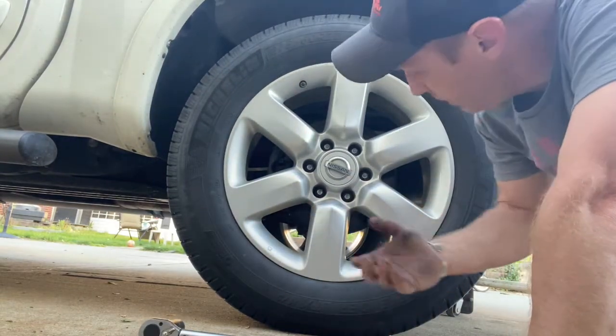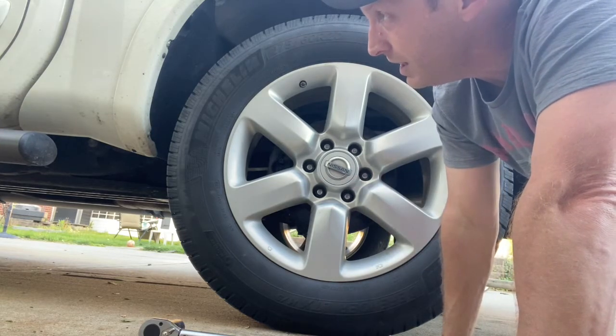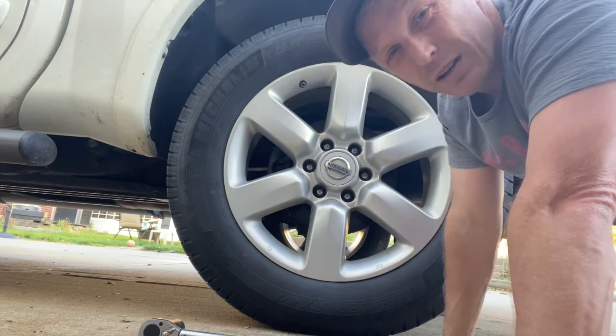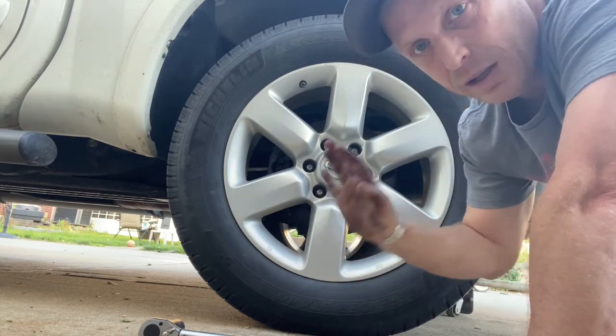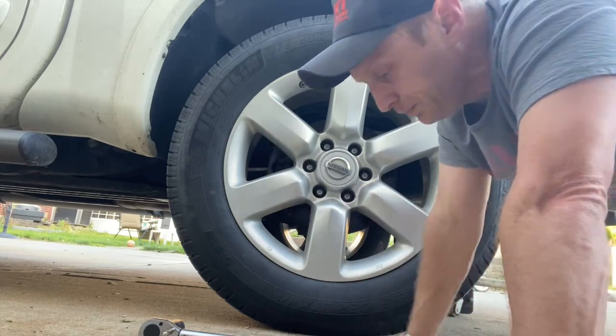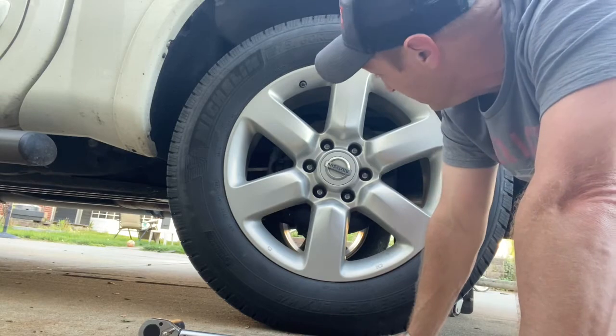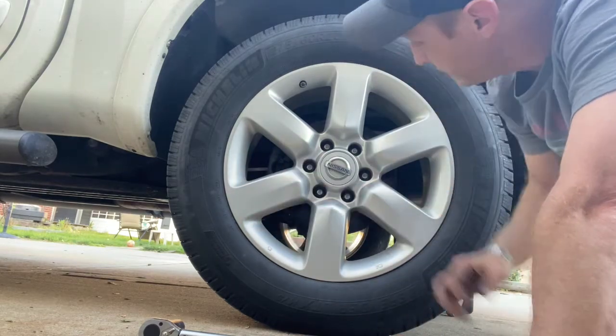That concludes rear brake pads. We work on the front the same way. The only difference on the front is the rotors are wider. Sometimes the pads are a little bit bigger, but it's the same setup. If you have a pedal pulse under normal braking, where you have a weird vibration in the steering wheel, then you've got a rotor issue and you should replace the rotors as well. This one pulled dead straight, but I was starting to get noise, so you pad slap it.